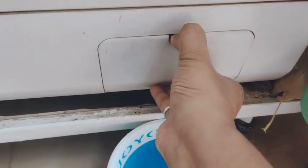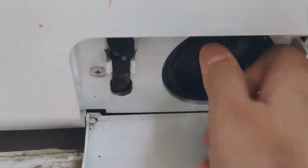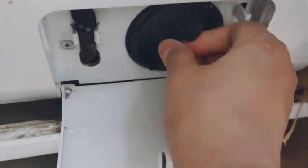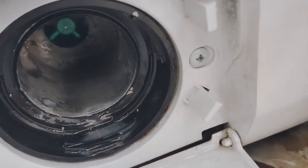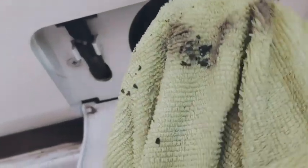Now the second part. Under the washing machine, you will open a little door. Be careful when you open it — you will need something to catch a lot of water. If it doesn't go out of the outlet, you can store it here. We need to clean it like this. You can see how bad the dirt coming from here is.